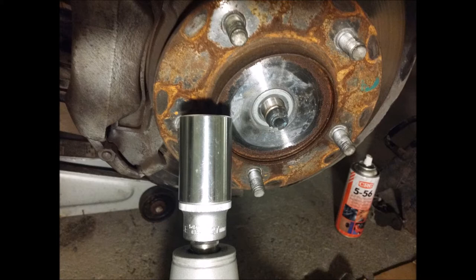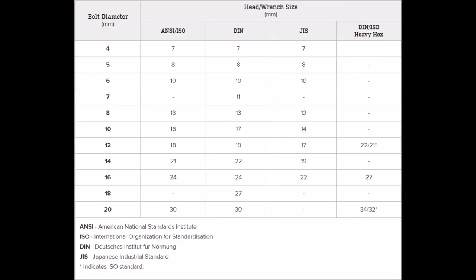You'll also need a 27-millimeter socket, which is generally not widely available — I had to hunt around town to find it. In Sweden I found it at Jula. Note this is a standard socket, not impact-rated at 27mm — they don't even sell that size in impact. In my case I removed the nut with my impact wrench using the standard socket with no other choice. You should source the 27-millimeter socket before you begin your project, as it is not a common size most shops carry.